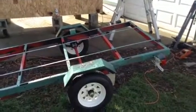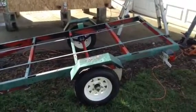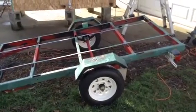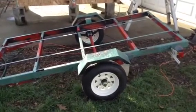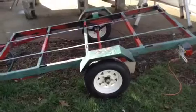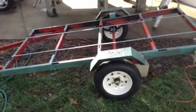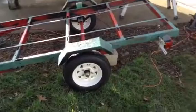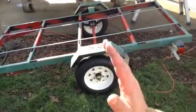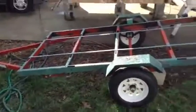When it rocks on that pivot point, it lifts up on the trailer tongue, which in turn lifts up on the axle of the towing vehicle and can cause the tow vehicle not just to fishtail but to lose traction and slide off a mountain. That's one of the reasons for off-road campers and teardrop trailers people go with a double axle and keep the entire center of gravity low — you don't want it to be very tall. When we built the Ansar Palace, the original plan was for it to be only about four feet tall, but we decided he's really not going off-road since his pickup was two-wheel drive anyway. That's why you don't go seven or eight feet tall on the off-road ones without having a much wider footprint or double axles to provide broader stability and prevent that rocking that would cause the trailer tongue to rise up.